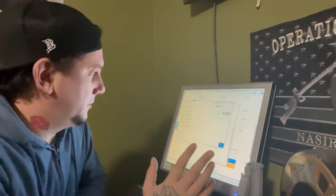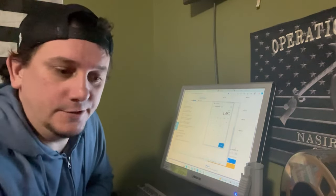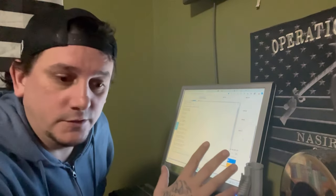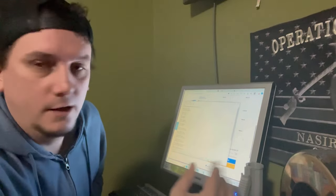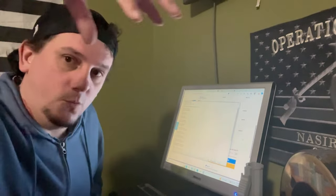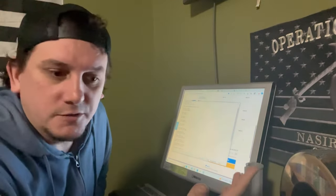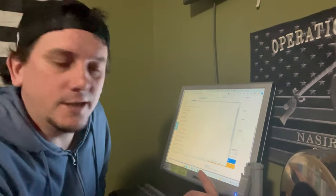I've sourced all the suspension parts, and directly from Ford it's $3,900. If you're running Gen 2 like I am — and what I mean by Gen 2 is the second generation of the Raptor — these are all Gen 2 parts. You also have to replace your bucket, which is what holds the top of your suspension — the easiest way is with a Sawzall. Those are $550 for the buckets from Crazy House Customs. That's what I have on my truck, that's what a lot of us have.